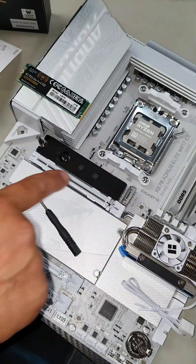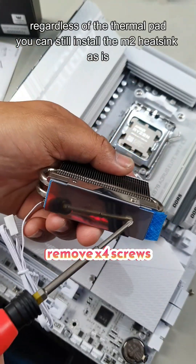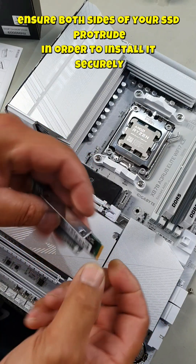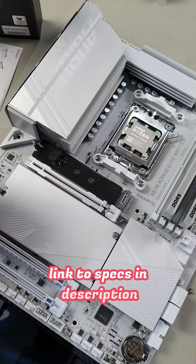Let's remove our heatsink. If you have a protective sticker here, remove it. Go ahead and remove the four screws that retain the bottom plate. Peel off the protective stickers, place your SSD and so on. Be sure that it does stick out on both ends, get it as centered as possible and have enough space on each side in order to install it. Realign your holes.